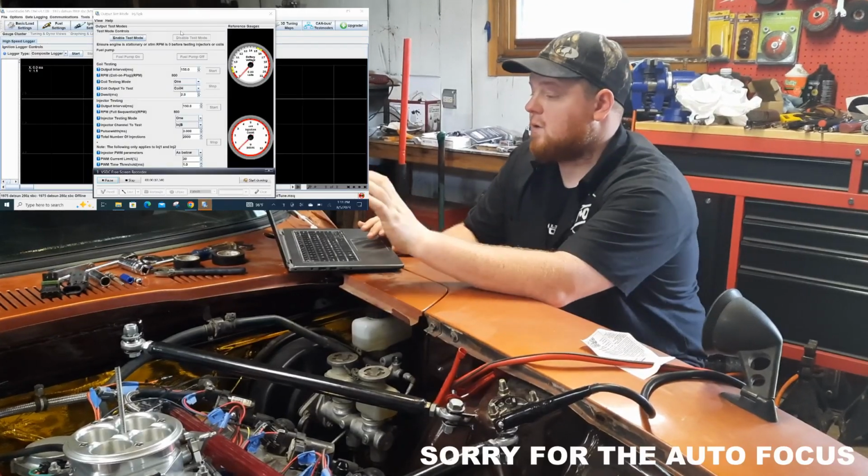It's kind of goofy, because when it's at top dead center, the mark is on the balancer, it comes in at maybe like a 10-degree angle. The sensor is at like an 80-degree angle from top dead center, and then the missing tooth that actually times this engine based on the computer is in between both of them, and that's not typically how you want your deal all the way around. But because it's all electronic, it's relatively easy to get that all lined up as long as you know what you're doing.